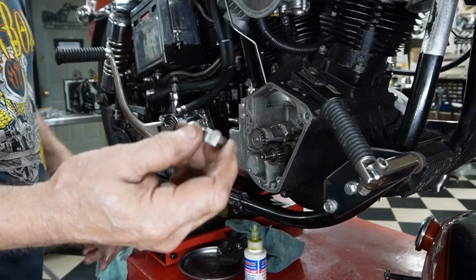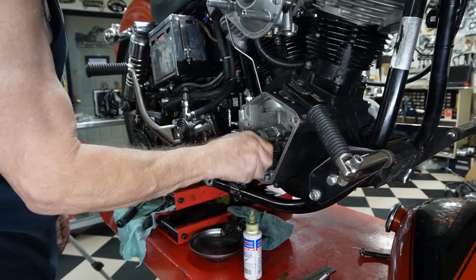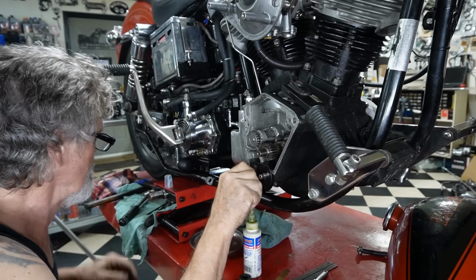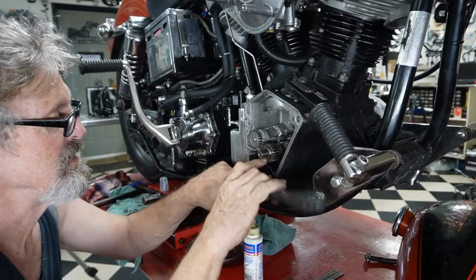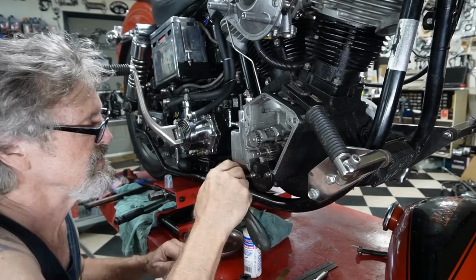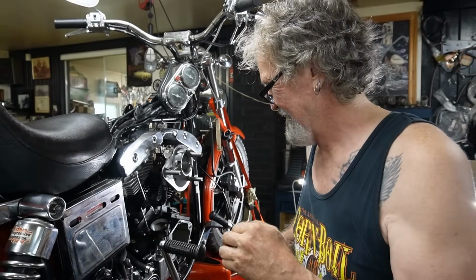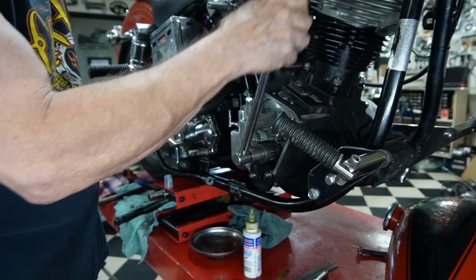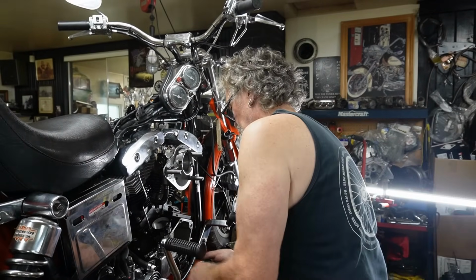There we go. Take our pinion gear nut, which is left-hand thread. This will lock the pinion gear in place so that we're able to torque it. It locks into the teeth of the pinion, so it can't move. Take my little tool that Pauline made me back in 1990. It's cut out special for it. And there we are. Okay. Take our little tool off.